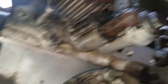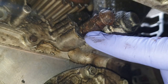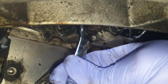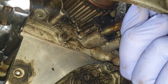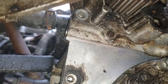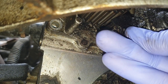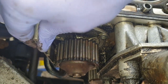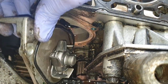This last one is a 13mm on the main shaft here. This is quite rounded off, so rather than undo both, I'm just going to undo it the old-fashioned way with a spanner. Now this pump has got two dowels that it sits on — one here and one further up — so it should just pull off. I'm going to attempt to do this from the top instead. It should probably come off a little bit smoother than that.